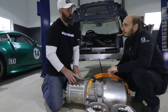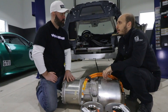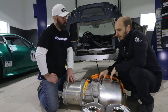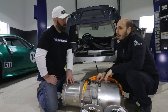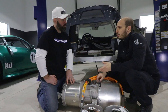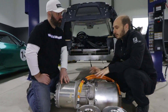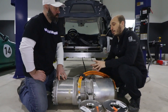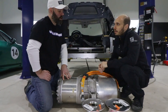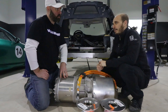We definitely have a little bit more testing to do, but the main reason for the initial dyno testing was to make sure we weren't in limp mode. A common problem with guys trying to get these Tesla motors going is they get stuck in limp mode, which limits you to about 70 kilowatts of power. Luckily we were able to exceed that — we made about 280 horsepower, so we're not in limp mode. The one thing not working yet is regenerative braking, which we still have to sort out with the guys in Switzerland.